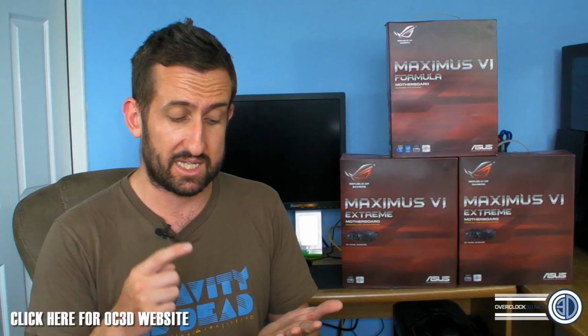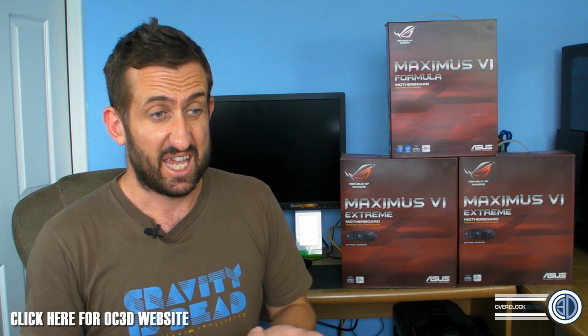It's about, like I've said, package, maybe what IO it is. Do you need more SATA ports? Are you that fussed about multiple graphics cards in the not too distant future? If you are, you'd want to buy one with 3 slots between, so that if you're air cooling, the graphics cards aren't going to be sandwiched together. It really does come down to that kind of level now.